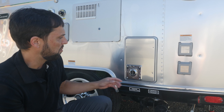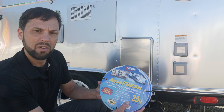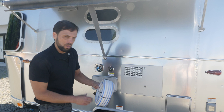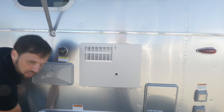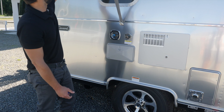The fresh water hose is 25 feet and provided by Colonial Airstream. Airstream has a water pressure regulator built right into the city water inlet, so you can hook the hose directly to the trailer or use an aftermarket inline water filtration system. There's also a drip tube in the wheel well for the air conditioning condensation — a drip in front of the tire is normal and by design; most RVs let water run down the sides and stain, but Airstream puts in the extra effort of a dedicated drain tube.